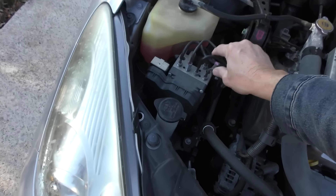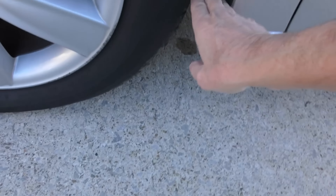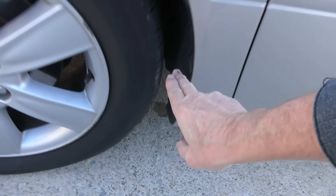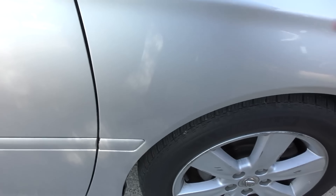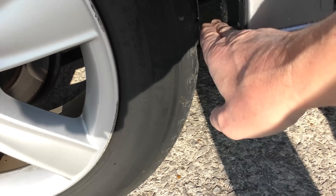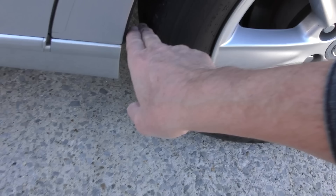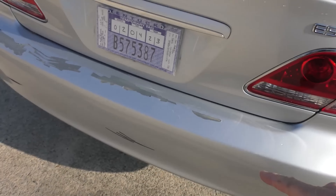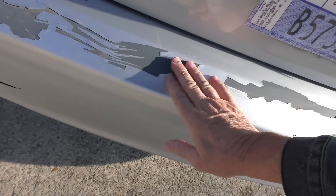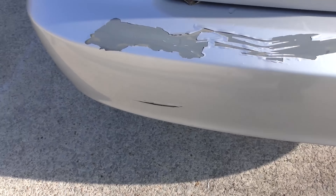All the systems are green — the ABS is green, so that's going to be working okay. It doesn't overheat. There are no obvious signs of wrecks. We've got a little over two fingers of gap on the left front, same thing a little over two fingers on the right — the car hasn't been wrecked in the front, at least anything obvious. In the back again it's two fingers on both sides, so it hasn't been all squashed in and all the seams line up. Yeah, at some point somebody has hit this and wrecked the paint, but it didn't break anything — that's just paint, it can be resprayed.